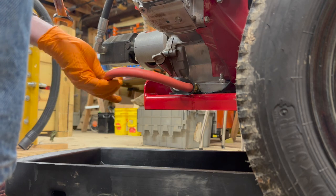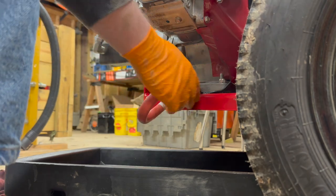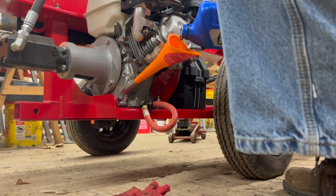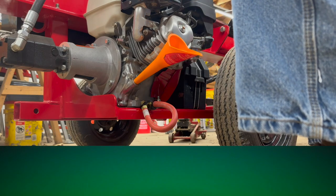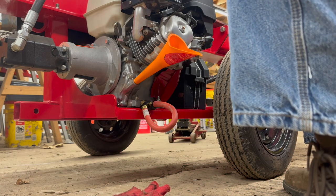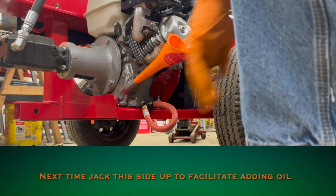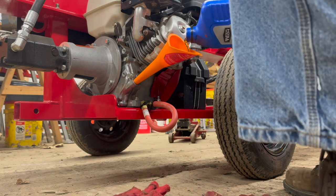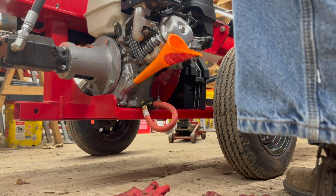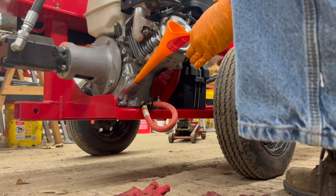That should be tight enough. I'll keep an eye on it. I'm going to secure it in the loop and put it on this side of the engine. I don't think that's going to fail, but if it should, Honda engines have a low oil switch and they will shut off automatically if the oil would spill out of the engine and create an environmental hazard. We don't want that to happen, but if it should, the engine will not get damaged because it has the ability to shut itself off when there's no oil in the crankcase.